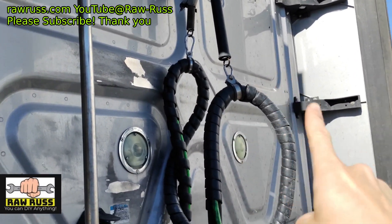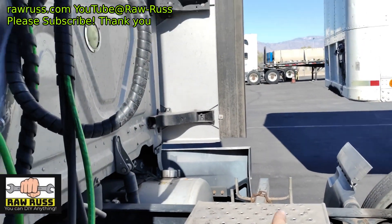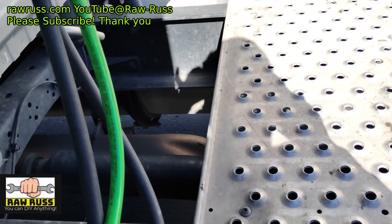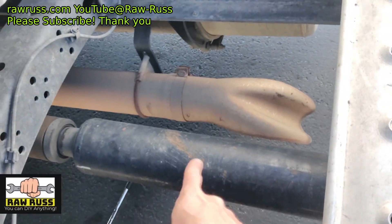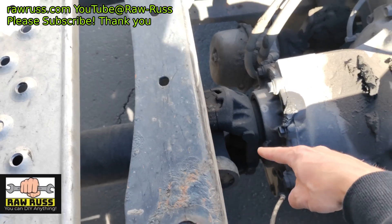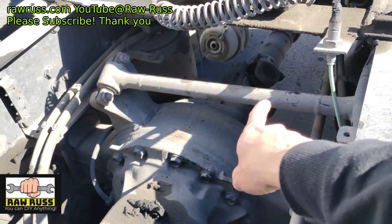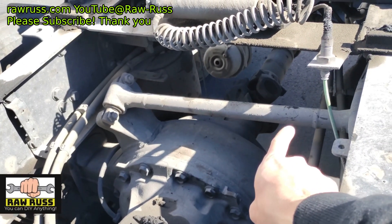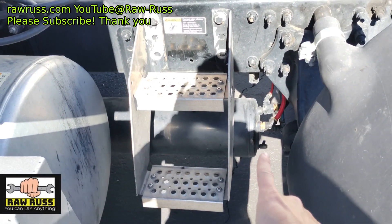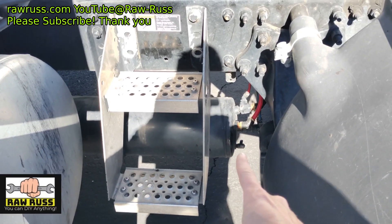We're going to check our fuel tank on the driver's side — make sure it's securely mounted, no missing hardware, not cracked, bent, or broken, not leaking, and the cap is securely tightened. Make sure the pigtail is not dragging on the truck or catwalk and is free to pull in and out while making turns. Under the catwalk behind the truck we'll check our drive shaft — securely mounted, no missing hardware, not bent, broken, or cracked. Behind that is our torsion bar — securely mounted, not bent, broken or cracked, no missing hardware, and the bushings are in good condition. Finally, check that the air tank is not leaking, not bent, broken or cracked, and is securely mounted with no missing hardware.